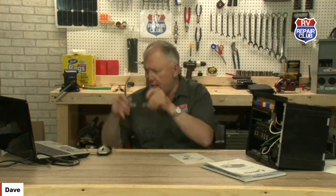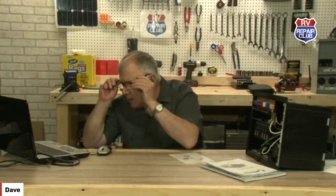And I do like the REDARC DC to DC charger. What that does is it regulates the charge from your tow vehicle or your engine alternator. You've got a camper van with the Dodge. So I don't know what size alternator is in that, but these Mercedes have 225 amps that they're charging two engine batteries with. And so now you're able to throw that into your lithium batteries if you don't have this DC to DC charger in line to that.